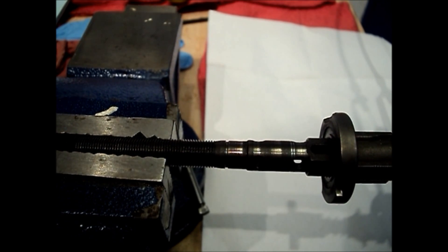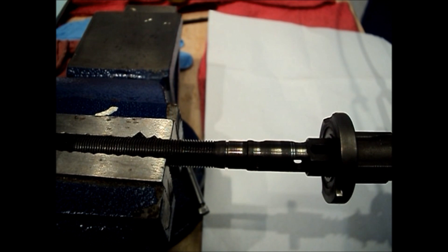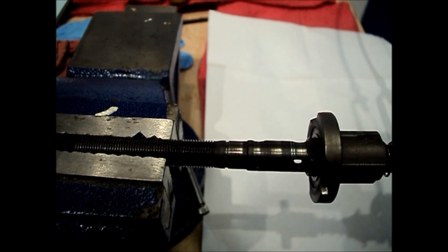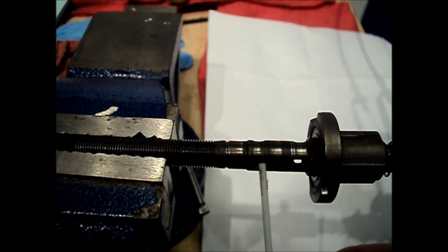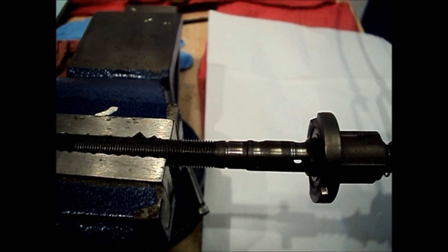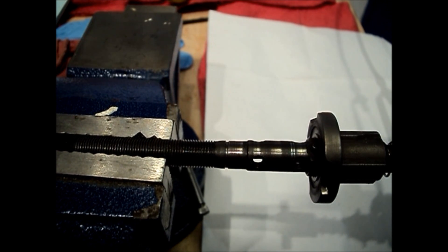When we go to third gear, there's no change. Which of the sun gears is coupled to the axle has no bearing on third gear as it's a direct drive. In fourth gear, again no change, because we still have the smaller of the sun gears engaged to the axle and the large one free rotating. In fifth gear, once again they change places — the small sun gear is released to freely rotate and the large sun gear is once again coupled to the axle.